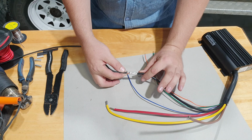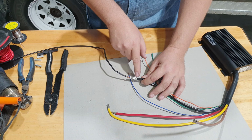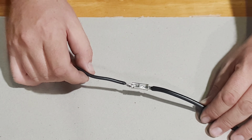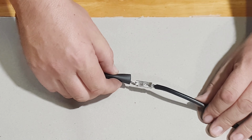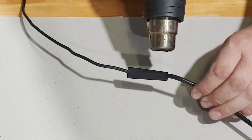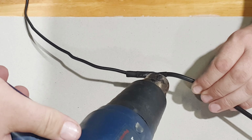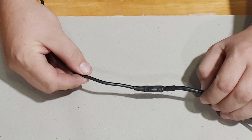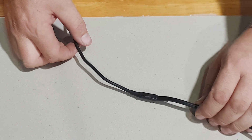Right, there's your mechanical join. Now you want an electrical join. The mechanical gives you your strength from pulling apart. Now you want the least resistance, so we have to solder the whole length of that, fill the whole interior of that with solder, to give you the best join possible, least resistance. Once you're happy, you've filled solder in both ends and it's filled with solder the whole way through for a good connection, you want to slide up your heat shrink as provided. Done. A complete join. Finish the rest. Convoluted tubing over the whole wiring, and then we're ready to install it.